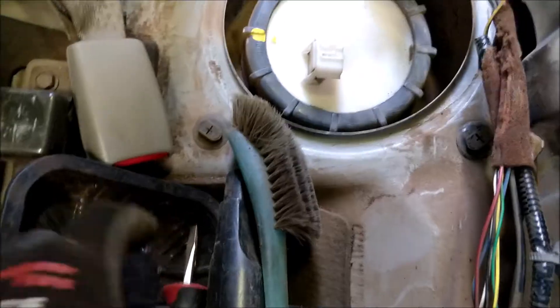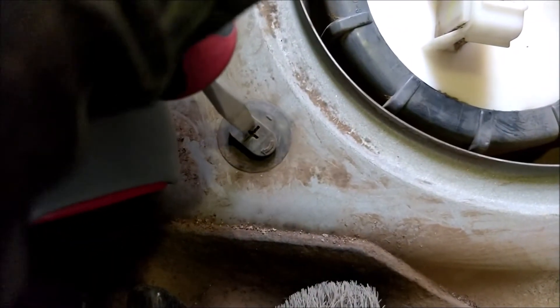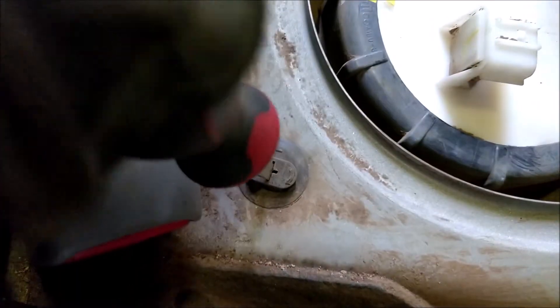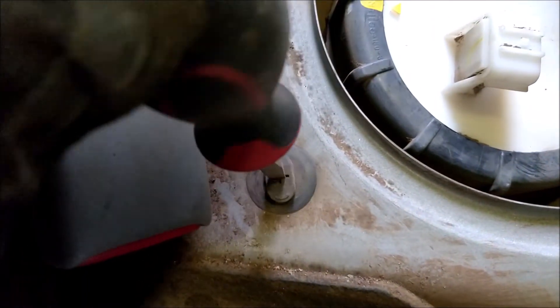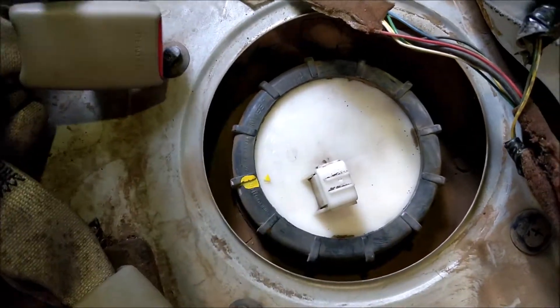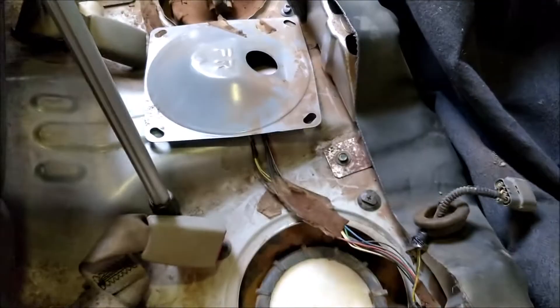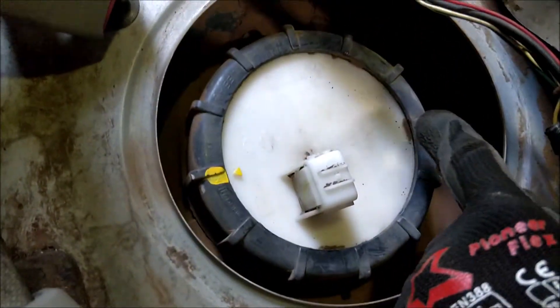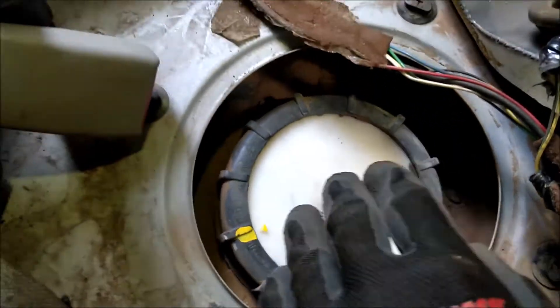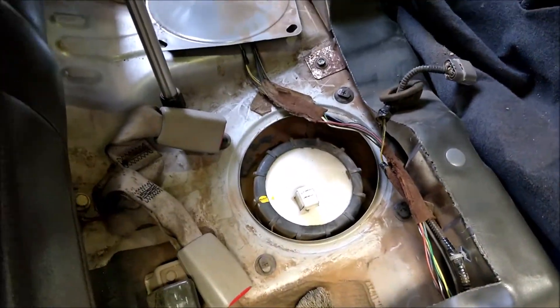So like I was saying, the locks are 5mm and this one goes smack in there — perfect fit — so he doesn't end up breaking it. Flat screwdriver for the win. And as you can see, it's good to clean up because that is the original color of the plastic, while the uncleaned one — well, you can tell for yourself. We'll do the same on that side, disconnect, and just make sure it's nice and tidy. The risk is if you open this up without it being clean, you will dump all the junk into the tank and that'll be a problem for your fuel system upstream.